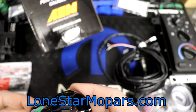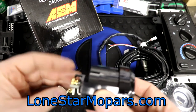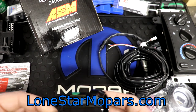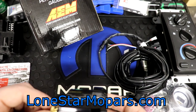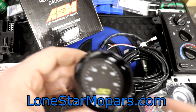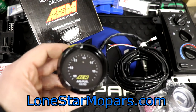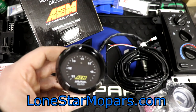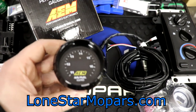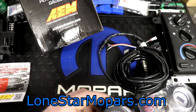I'm not going to go into science fair mode here on AFR readings. Honest to gosh, what this is going to be used for on the truck is quite simply tuning — it's going to be very, very important for dialing in the tune. And then, as somebody that's somewhat into this stuff, it's going to be cool to monitor down the road. A gauge is an insight to the engine — you know the oil pressure, you can diagnose things before they happen. With the AFR, if we ever start having stuff go down — whether it's two weeks into driving the truck or seven years — and we see the AFR isn't quite what it usually is, that tells us something's not quite right, let's investigate it.